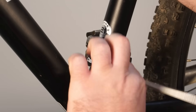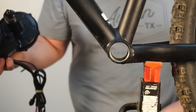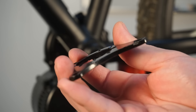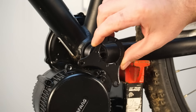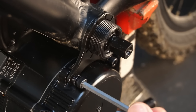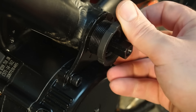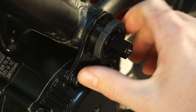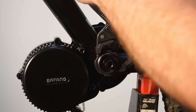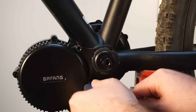If your bike has a front derailleur you'll need to remove it. One side of the motor bracket has raised ridges — these need to be orientated inwards to the bike. Install the M6 screws but leave them loose for the moment. Install the motor locking ring. To tighten the locking ring a special spanner is needed, which I had to improvise with on-hand tools. Now you can tighten the M6 screws.